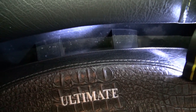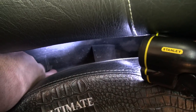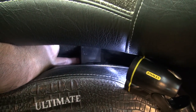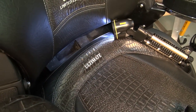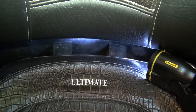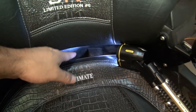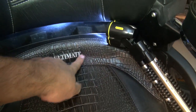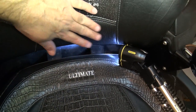The other part of taking apart this seat — right between the backrest and the seat you have two 10mm bolts, one on each side. You've got one there and one right across, and you've got to try to get in there. As you can see when I say cramped, that's what I'm talking about — it's kind of hard to get in there. What you're going to need is a very small ratchet with a 10mm. I'm going to be taking off the backrest so I can actually have more room to play with, because the stock seat finishes right here and I don't have much room to crank that ratchet.